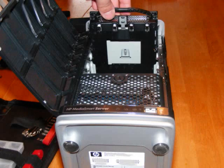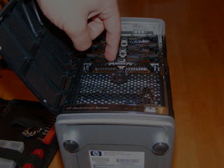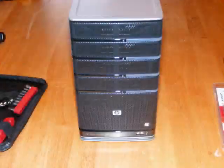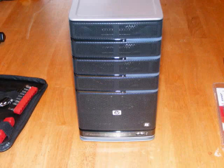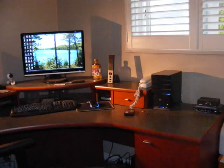Put your hard drives back into the slots. Tighten everything up and make sure it's all latched in. Then change the unlock to the lock position. And there you go — that's how to upgrade your server from half a gig to two gigs DDR2. Now you can go ahead and do all your add-ins and rock on.